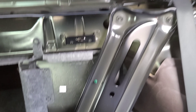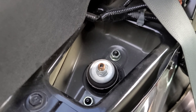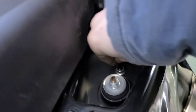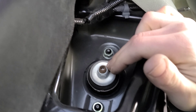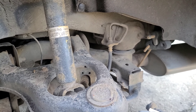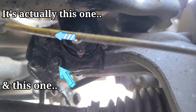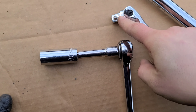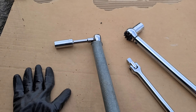If you didn't see part one, I showed how to remove the rear seats. What you're gonna have to do is loosen these two — it's so much cleaner and nicer in here than the front. Once you've got your 14mm, go ahead and loosen these up finger-loose. After that, save this for the impact gun later. What you're gonna do is remove that bolt there — those look like 10mm or 12mm, but you're gonna need a 17mm for that big bolt. I actually broke my half-inch to 3/8 drive adapter and haven't gotten a new one yet, so hopefully this will work.